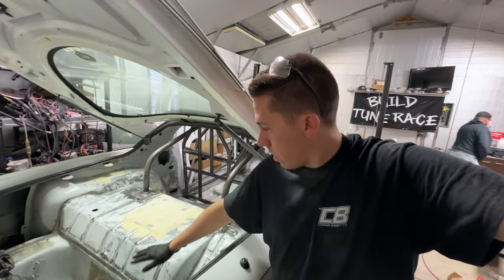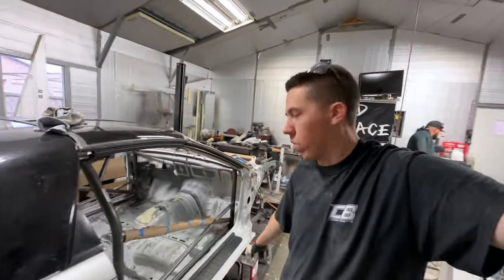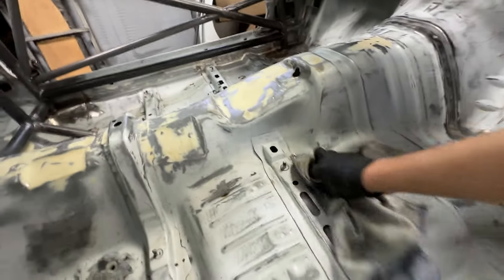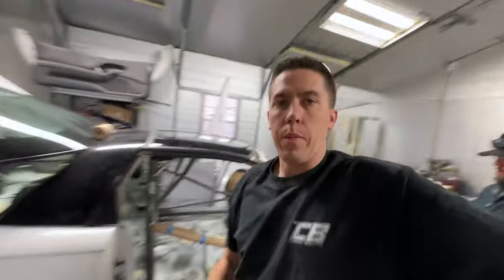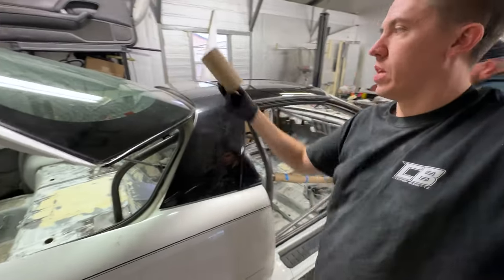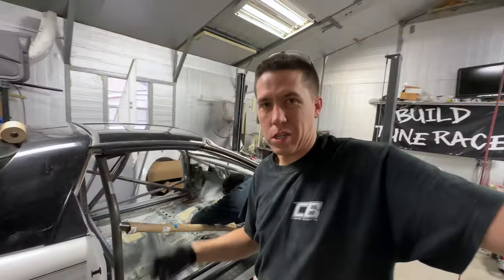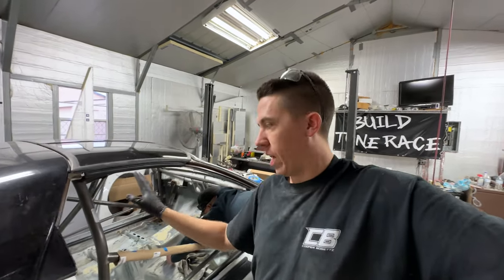What we did today is keep sanding, cleaning any little spots, and now I'm wiping the whole car down with acetone — just taking a rag and wiping the surface. We blew the car out a bunch already, made a big dust storm. Now Alex is working on taping off the bars, covering them with paper so we don't get that textured stuff on them, because later on we want to come back and put a regular black on the bars.